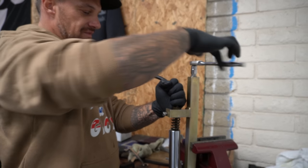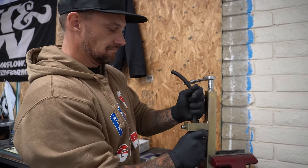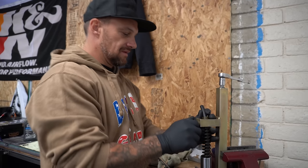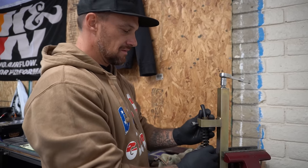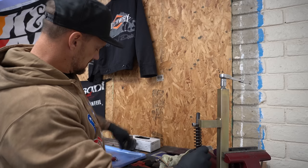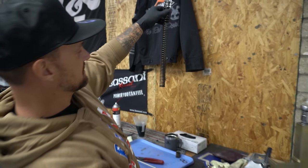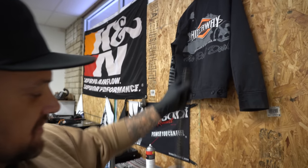This gets kind of hairy from time to time. See what I mean? All right, now that's loose. Take this guy, little washer, spacer, set them over here in order. Spring's gonna come out. See how the spring has tighter coils in the bottom and they're real open up here and they're real tight down at the bottom? Tight coils always go down.